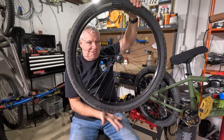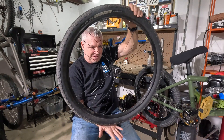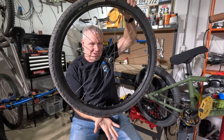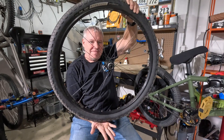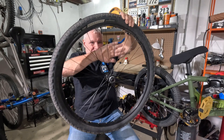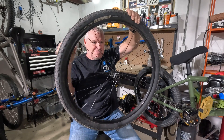So just a quick recap: the spokes up top are what support the wheel when pressure comes from below. When you land hard off a jump, the top spokes get activated and hold the whole wheel in place, while the bottom spokes relax and don't do much — it's all happening up top, pulling the rim down toward the hub. Hopefully that makes sense. I appreciate your support — please like and subscribe. Peace.